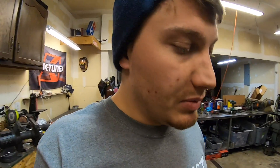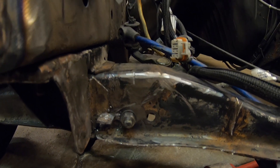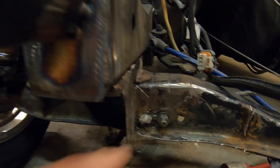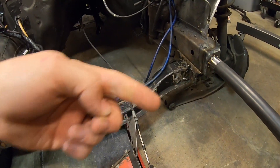We are back - it's the next day. I went ahead and got this crossmember off. I was going to drill the holes myself but I definitely was not going to drill them straight, so I took it to my machinist and had him drill the holes an inch out and it looks like it fixed our issues. This is the other hole - you can see it's already got the bolt in it, it's about an inch out from the other one. I cut the old motor mounts off of the crossmember on both sides so we could drill the holes through them.